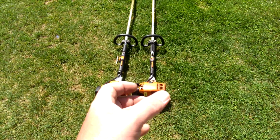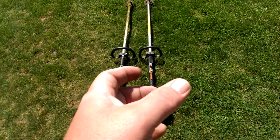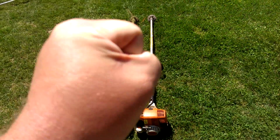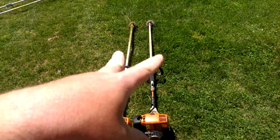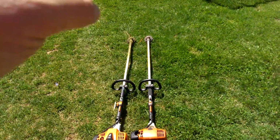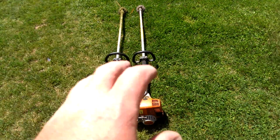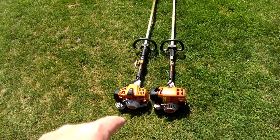When that piston's going up, it's pressurizing the fuel and air mix, right? It's just pushing it so tightly wound, and then when it gets up there, the spark plug ignites it and causes combustion and pushes that piston down hard. So your 4 strokes are going to have a whole lot more torque, when a 2-stroke only does 2 cycles up and down.